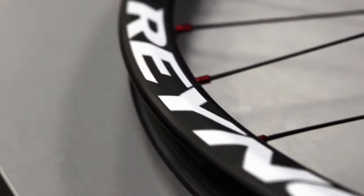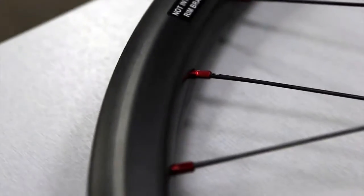The rim itself is already tubeless compatible. All you have to do is wipe it down with a little bit of rubbing alcohol, put the supplied tape that they give you on, and they will air up and seal with some Stan's sealant, of course. Seals the first time — at least ours did — very quick, very easy to use, really happy with it.